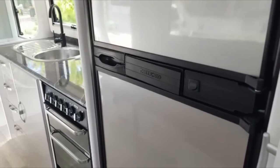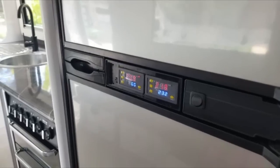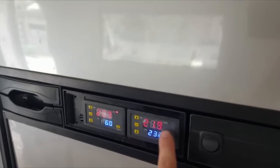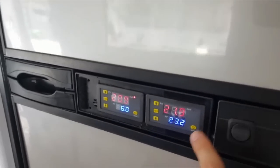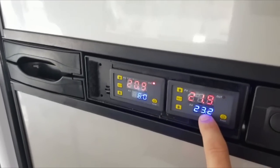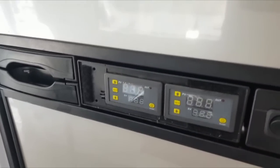This one's super easy and super cheap. I got two digital thermostats off eBay and installed them — one's fridge, one's freezer. It's off right now, that's why they're both showing 20 degrees. I also installed a buzzer so that if it goes below the set point it will beep, and a switch so it's not always running.